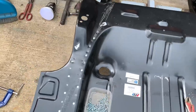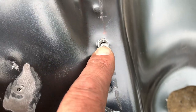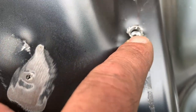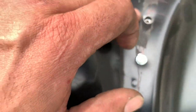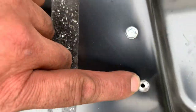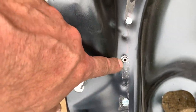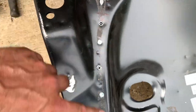I wanted to show you something here while drilling it out — in certain areas where there's multiple layers of steel, you can see how deep that hole is drilled. We've got the thin sheet metal for the trunk floor, there's an inner brace, and then there's the frame itself. So we're almost a quarter inch — or three-sixteenths of an inch deep on these holes to finally get down to the base metal. You've got to drill through all the layers. Two layers are pretty simple — you punch through the thin sheet metal on top, then hit the frame. At that point it's ready to weld. Now it's going to zap and fill those things in. The weld lays down flat, it looks just like a plug weld, but you've got to be careful to get all the layers tied together. You've got to drill pretty deep and start welding from the bottom and fill the thing up.